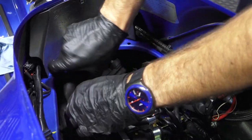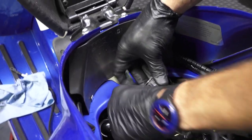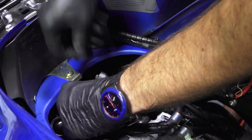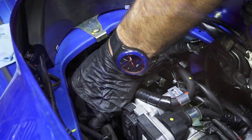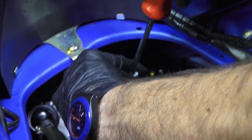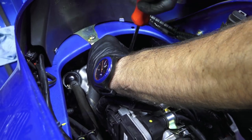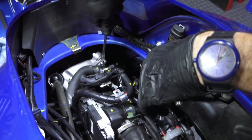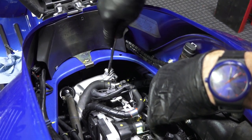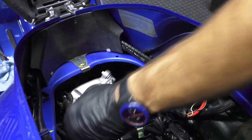All right, so we got some hoses here. Make sure that's good, hose clamp. And I'm gonna grab some hose clamps here. There's my number 12 style hose clamp. Pop the hose on, that's ready to be tightened. I got my airbox breather, another smaller hose clamp, number 6 hose clamp. See, I'm holding the clamp because I want the position of it. If you don't hold it, see how the thing will just want to fall. Something maybe you don't think about if you're not wrenching all the time, you start finding little things that make jobs easier. And it would even be easier to turn if I put a 7mm nut on the end, because you can use a Phillips, a flat, or a nut driver on this style hose clamp. That's hand tight. You see all my gold marks for where I had zip ties. You need a screw for that.